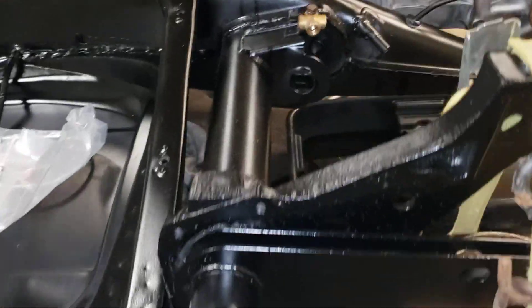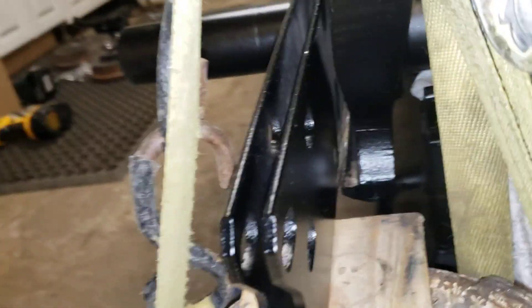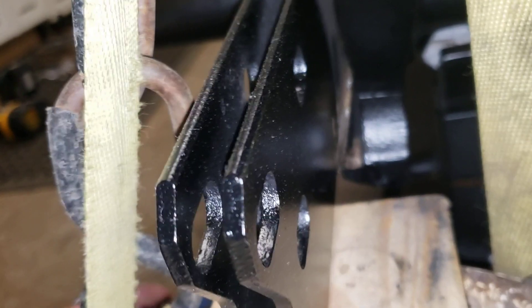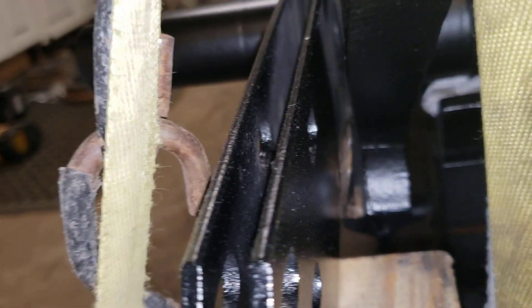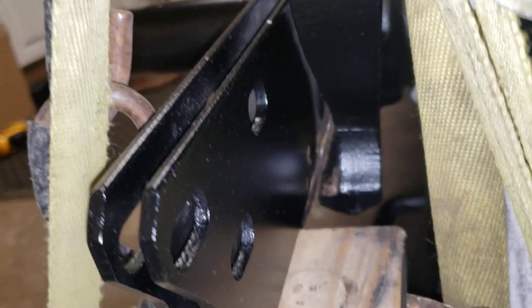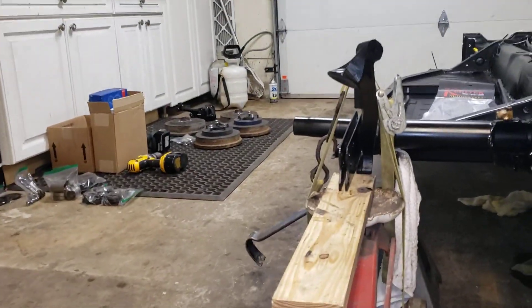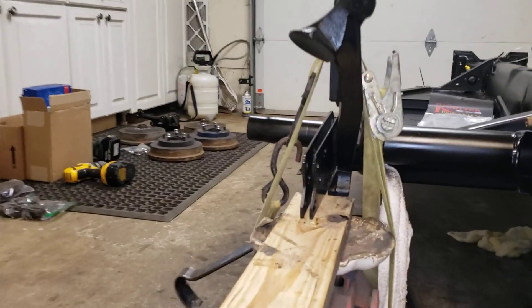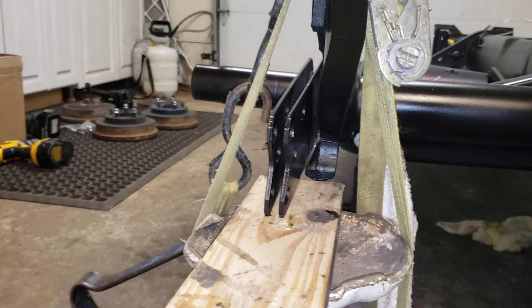This is an IRS car so it's a little different — it's got two plates instead of one. But basically the pry bar is behind that, acting as a ramp, so when this plate comes back down it's going to clear that hook. Now I go back to my floor jack, turn the handle, loosen it just a little bit, and we're going to start going down and watch that plate basically come right off of that hook without having to beat on anything.